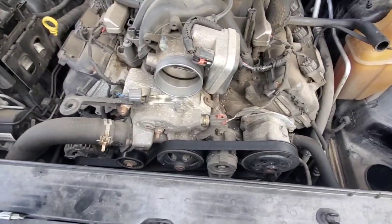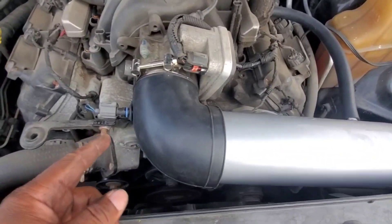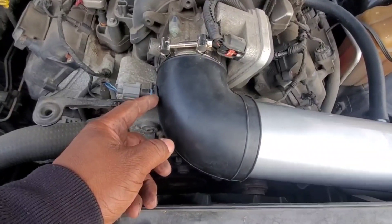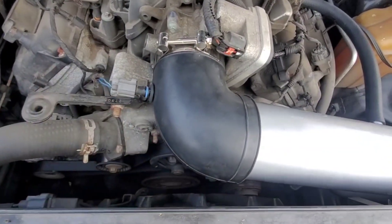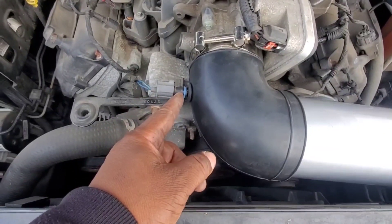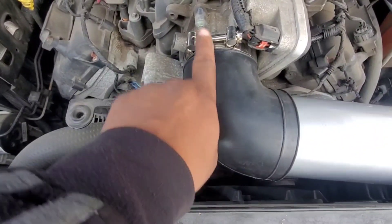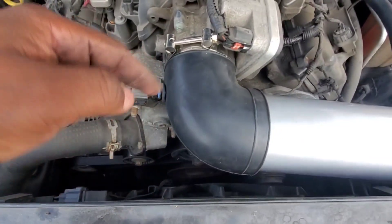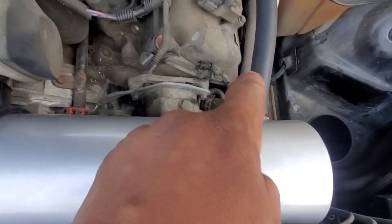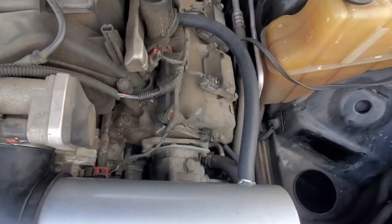Now I'm about to go ahead and assemble the intake and put it all back together. I'll probably get some type of sealing — like silicone, like that RTV gasket sealer — put it in around there so there's no little bit of air seeping out. Go ahead and connect that sensor back on there. Make sure that the colored tip part of the end of the sensor — the intake sensor — is facing center towards the throttle body. It shouldn't be to the side at all. I did take the brand new hose because it does fit this part better.